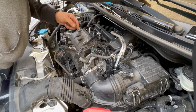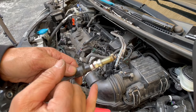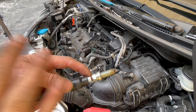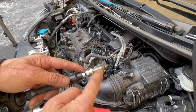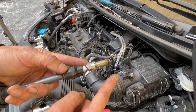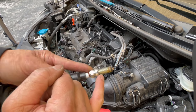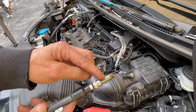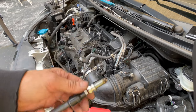Let me show you something before I go further. Usually when people put in new spark plugs they go, oh, you need to put anti-seize or some grease on the threads. If you're using NGK, you do not need that. NGK and Denso — I'm not sure about other brands — but NGK and Denso do not need any type of grease. From the factory there is nothing, no grease — it's clean. All this dirtiness on the threads is just from combustion. You don't want to put anti-seize or dielectric grease or whatever. If you're using NGK or Denso, you don't need any of that stuff.